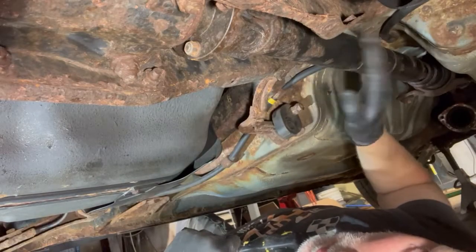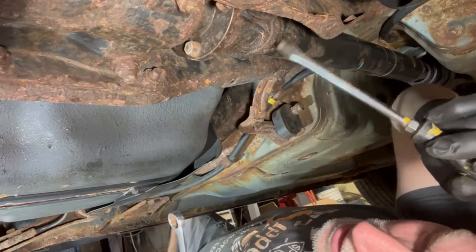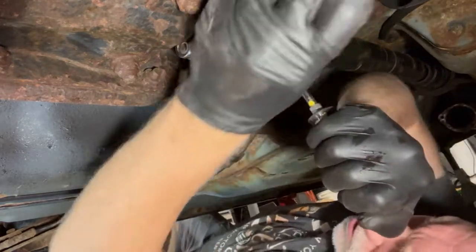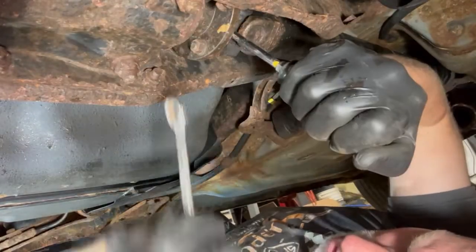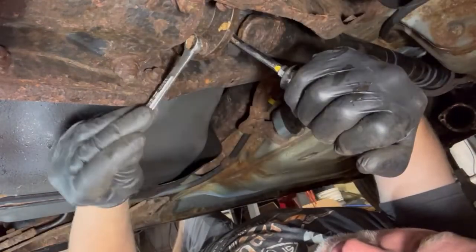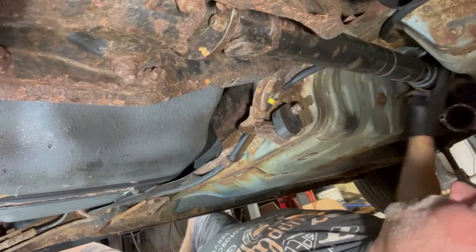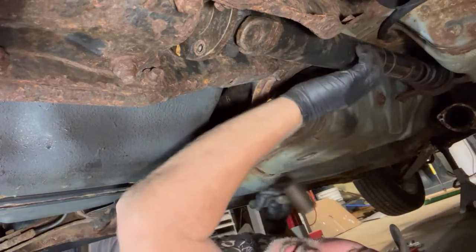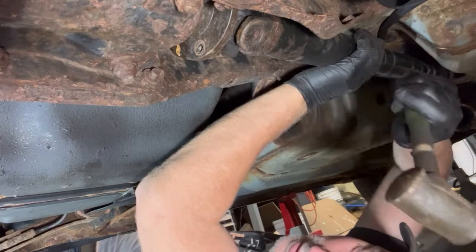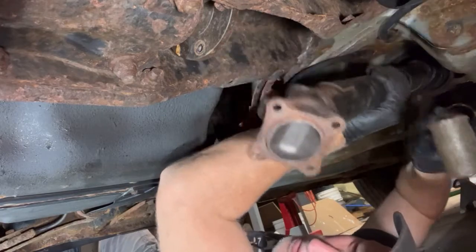Next up, looking from the rear of the car, we're going to remove the driveshaft. You've got four 12-millimeter nuts holding the driveshaft on. Easy way to do that is just put a screwdriver up through the U-joint, and then you can break these things loose — make sure you use a box-end wrench though, you don't want to strip these out. Get all four out, then drop the driveshaft down from this joint. You'll want to put some force towards the front of the car and tap it a couple times with a brass hammer — don't use a regular hammer, use a brass hammer or a block of wood. Don't create more work by damaging these U-joints.